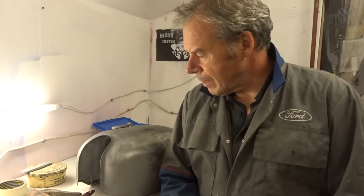If you've seen lead loading, it was replaced with body filler. In the early days, the body filler that replaced it was never that good. Nowadays it's very, very good, very flexible. But on this project, I thought we'd go a little step further and replace that with some metal. It's got a nice firm standing on there, and I think the customer's really chuffed that we are actually going to put some lead back in those spots.